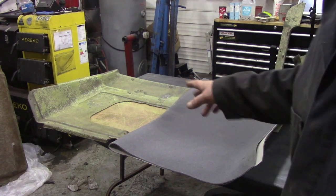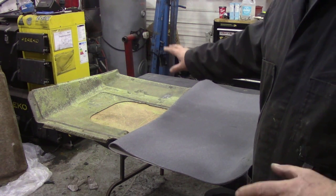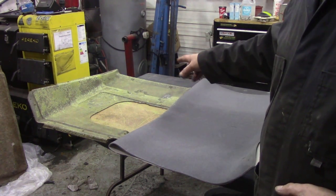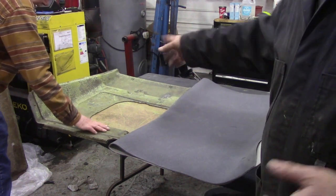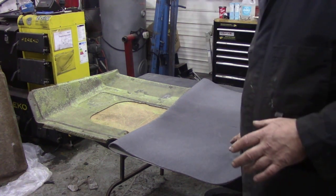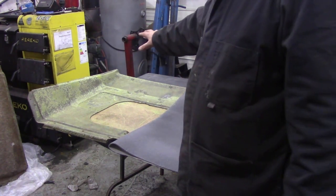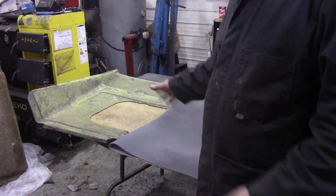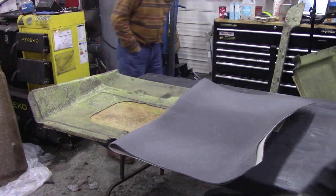What we've got to do is prime up these panels because they're so absorbent - they're sucking up the glue. We've given this a quick coat and it's gone off now - it's not sticking to itself anymore. So now we're going to give this one coat, because this doesn't absorb that much, and because we've already got a layer of glue on there it won't absorb. Then we can put it together.